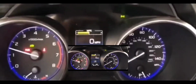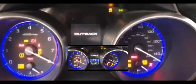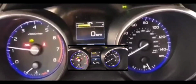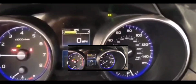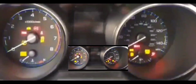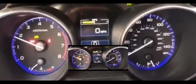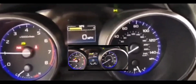All right, so I changed out the battery, and I had to go back, take the positive terminal off, take the negative terminal off, and essentially touch the positive and the negative terminals, the rings on the cable, together for a good 30 seconds to about 60 seconds. After that was done, I put the terminals back and started the car normally, and all the lights went off.